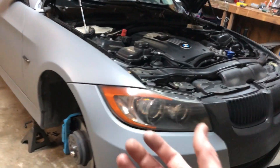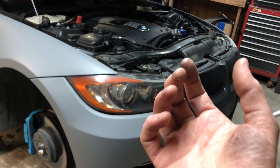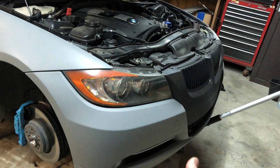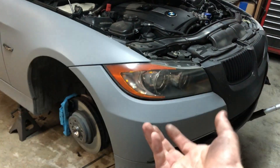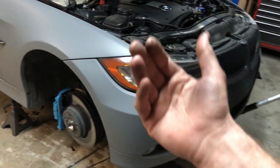This is a brand new one — let me show you where this goes. It's pretty easy to do. You have to move your steering rack out of the way so you can get to your V-bands. I also disconnected the O2 sensor so I could drop the downpipes out. You do have to disconnect both of them so the one I'm dealing with can wiggle out.